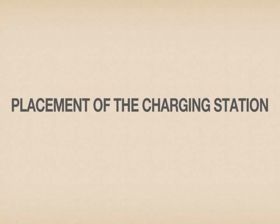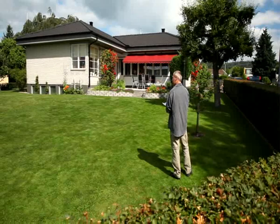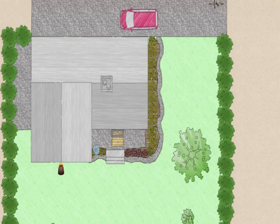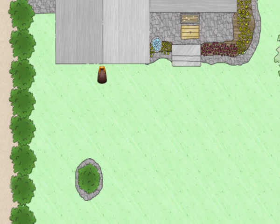Placement of the charging station. The first thing you should do is make a simple sketch of your garden to get an overview. This will help you plan your boundary and guide wire placement and the placement of the charging station. The charging station should be set up in a central place in the garden, with the mains outlet within 10 meters. Please never place your charging station outside the lawn area, and make sure that the cable connections are aligned towards the lawn end. For the mower to optimally function, there should be 1.5 meters free space to the sides and 2 meters in front of the charging station.